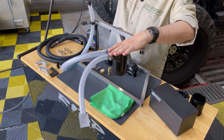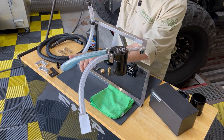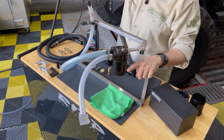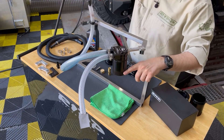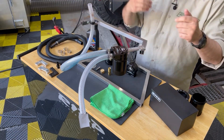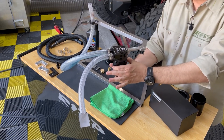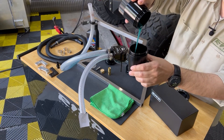I'm going to put the air right in here and the catch can is going to catch it, and clean air will come out the other end. You can see the oil is traveling into the can. The air is coming out the other side and there's no oil on it — no oil coming through. That means the catch can is filtering it, coagulating it, and catching it in the basin. What's coming through is clean air. Right now there are probably a few ounces of oil in there, and it all came out of the tube. Let's unscrew it — you can tell it's nice and tight.